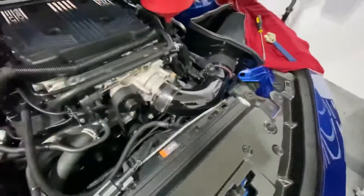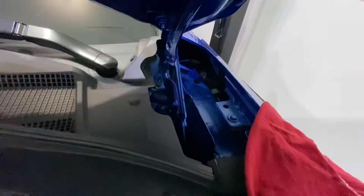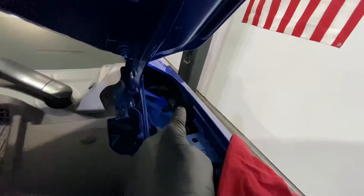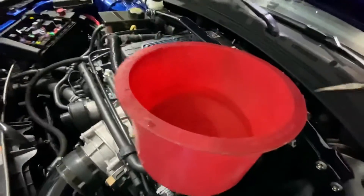And doing so, the pump comes on as you can hear. You can hear air bubbles because I have a driver's side fender mounted two gallon expansion tank. I ended up putting a rubber hose to a funnel and I filled it up with distilled water.